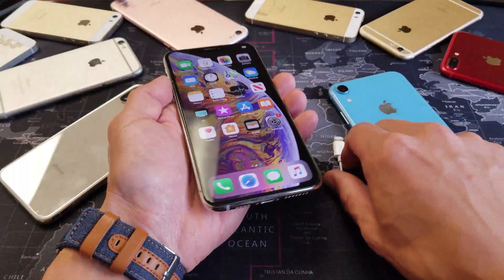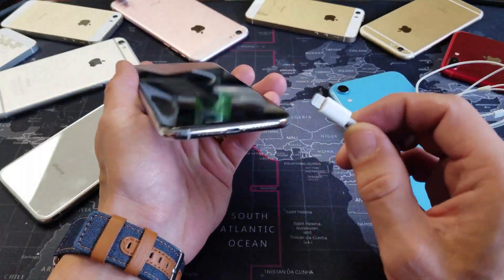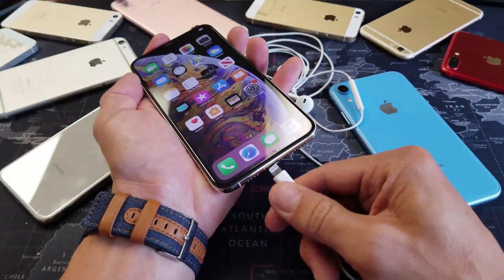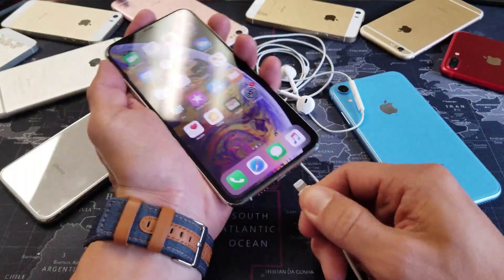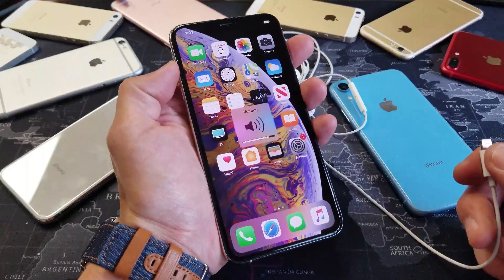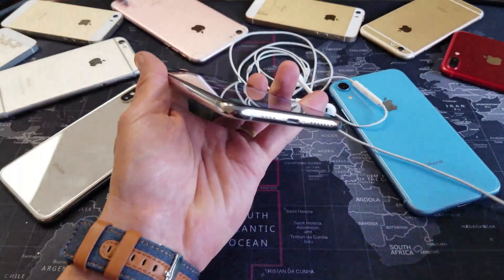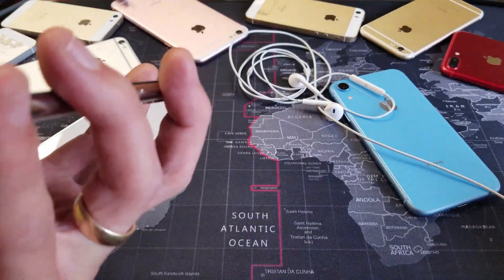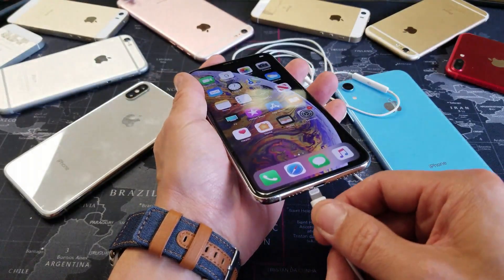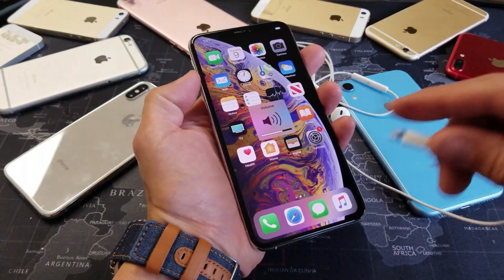The next method is go ahead and grab your earbuds. It's not a 3.5 millimeter jack on the newer iPhones — we actually use the charging port. So plug the earbuds in and take them out. In, out, in, out. Now go ahead and try it and see if it's still on headphone mode. If it is, try again. Also go ahead and blow right into that charging port, because it's possible you may have debris or dust stuck in there. Then plug in, plug out, plug in, plug out, and hopefully headphone mode is gone.